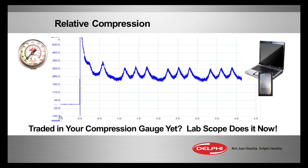It looks something like this. You still have the starter inrush, but now instead of rhythmic four bumps, four bumps, four bumps, we have one and then the current draw drops down. The engine may speed up slightly. Then you have three or four good-looking pulses of current and then another place where there should have been a pulse but isn't. That's cylinder number one — over and over again not drawing as much current as the others when it's turned to do TDC compression.